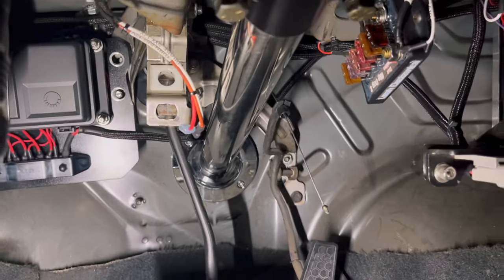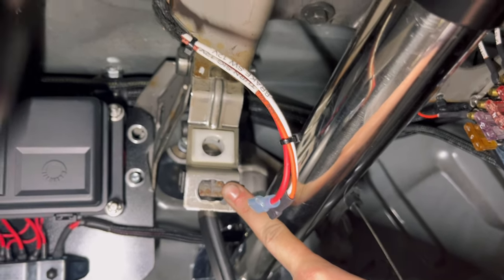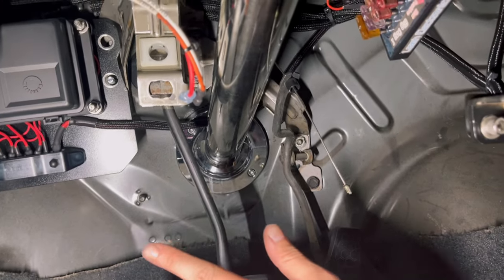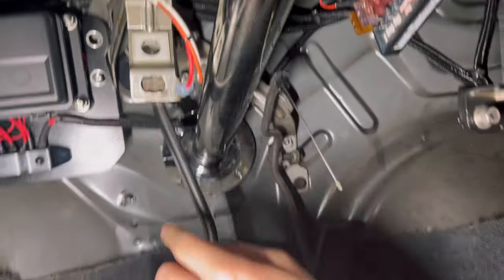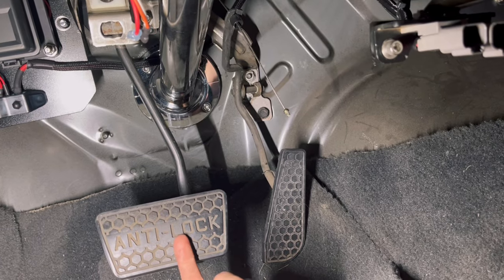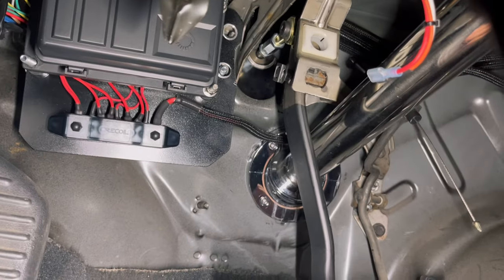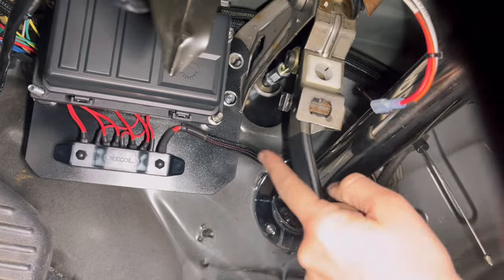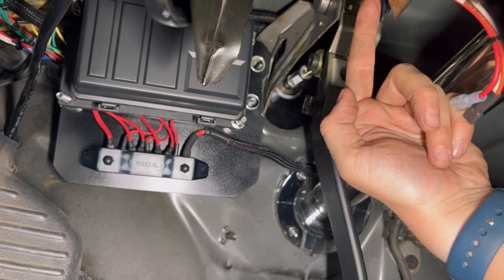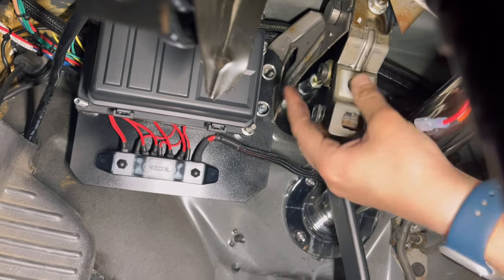I also want to make mention of another thing they talked about in Cletus's video, and it is actually this bracket. A lot of this stuff gets taken out when you're trying to reduce weight in a race car — things you feel are unnecessary — but this actually stops your brake pedal. If I were to push this and release it, it's going to stop it, whereas in the blazer this brake pedal can fly all the way up if it wanted to. If you watch the rod that's in the master cylinder here — if I push it down and this stop wasn't here, this rod can come out with the brake pedal. If it were to come out of the master cylinder, there's actually a lot of pressure inside of there so it wouldn't easily go back in by itself.